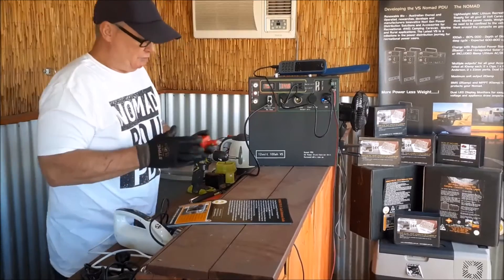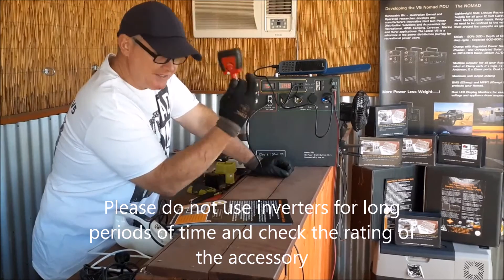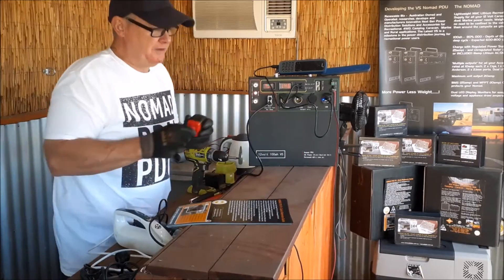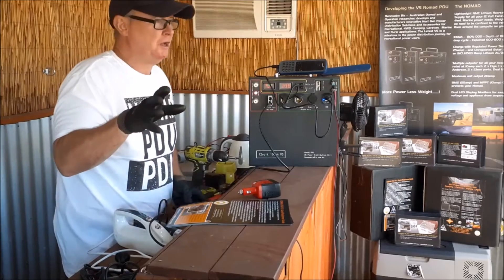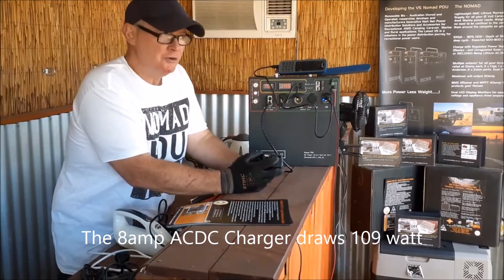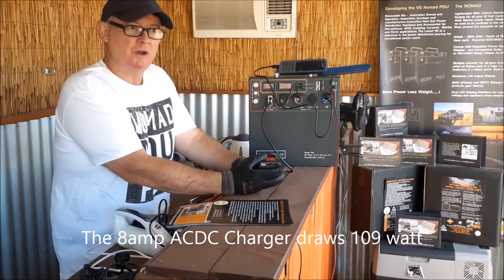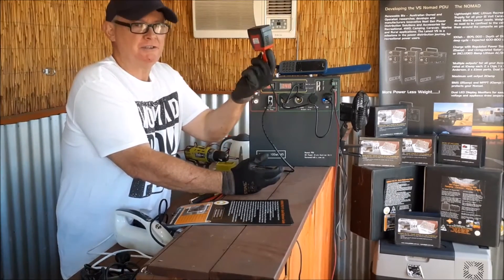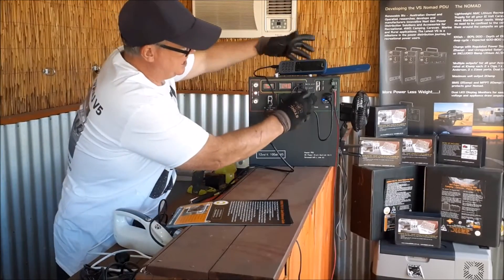One of the most useful accessories you can get are pocket inverters. These specific ones are a modified sine wave 150 watt inverter. It's important to realize this actual charger draws 109 watts, and most laptop chargers draw around 100 watts. Just because it's got a 240 volt plug, don't plug in your hair dryer or a 1000 watt microwave or blender — that will melt the inverter.